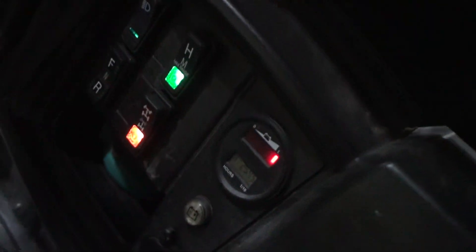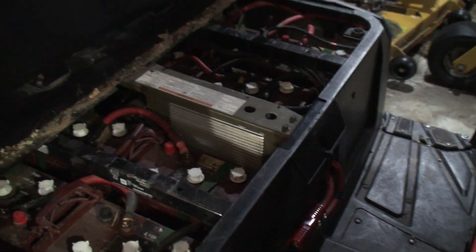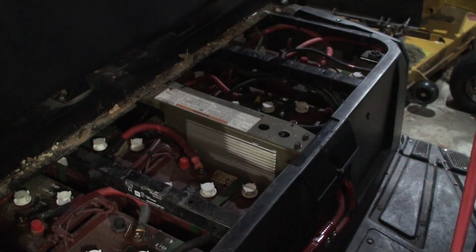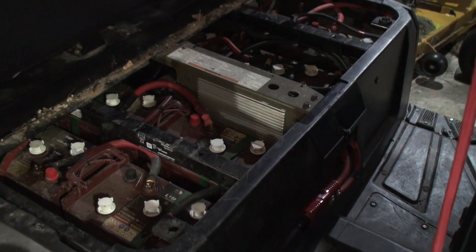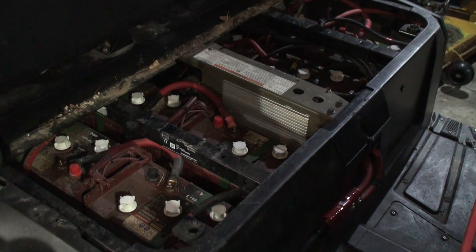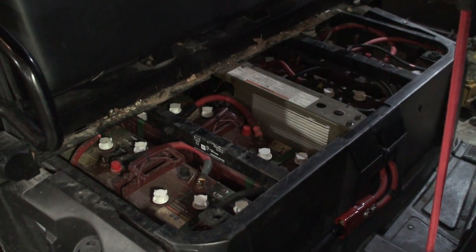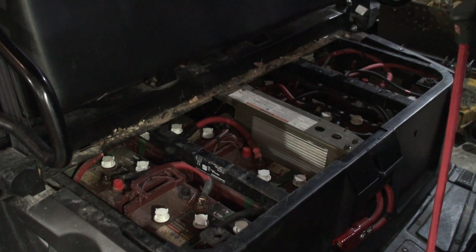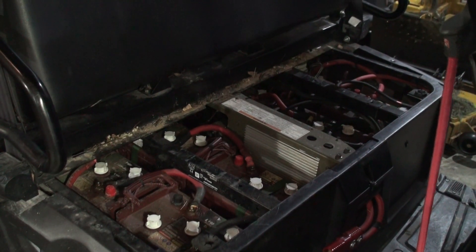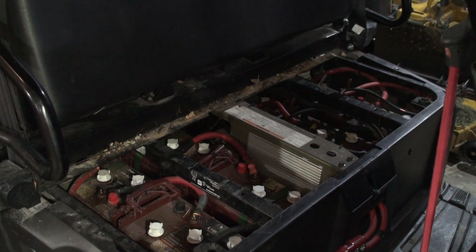Other than that, a little bit of noise. If I'd have bought Polaris U-joints, maybe things would have gone completely different. Sounds like I may have a CV issue. But I took the rear end apart and looked at all those gears and spacing — everything looked good back there. I had the motor tested and he said it was basically like new. I had to take it to St. Louis to have them put it on the machine and test the torque, and they said it was like brand new — they just blew it out and gave it back to me.